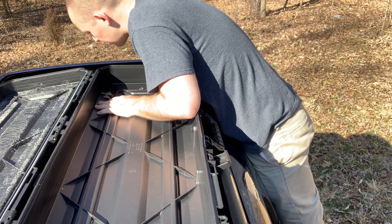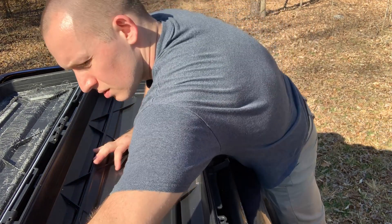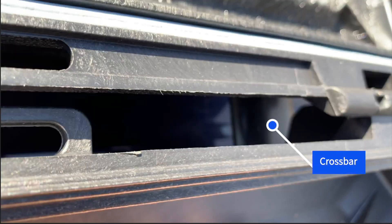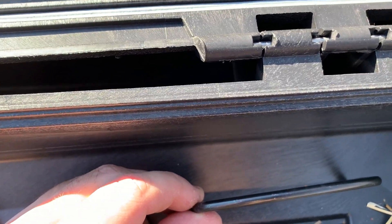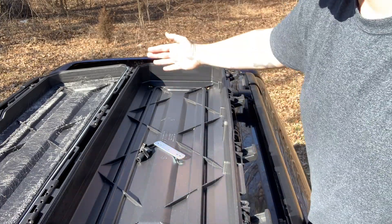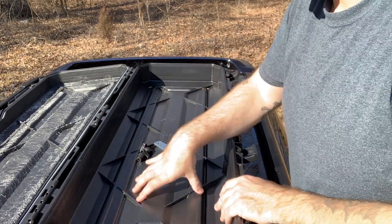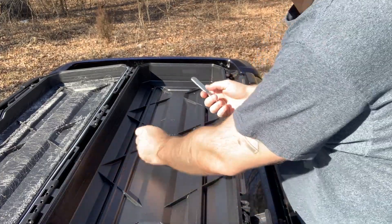I'm going to find the bar, get near the back, make sure it's clearing the rear hatch, then take one of these u-bolts. Look down this crack and you can actually see the bar. Take the u-bolt and go around the bar. Another tip: if the bar is too far in the back, loosen up the back bar and move it forward so you can work on it right in front of you. You'll have to move the box up a little bit, secure the box, then move the bar back and work on the front.